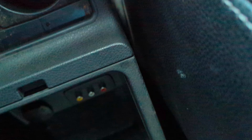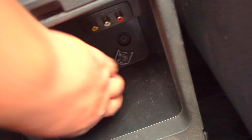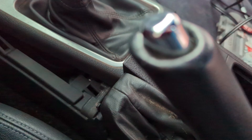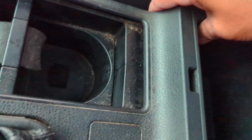I took all the stuff out of the center console area. You just take this little piece off and — oh yeah — you get free money from under there. I already got money back on my car. Pretty much just those two bolts in the back. You just need to move it out of the way. There's an Allen bolt up top and a star bit down here, so I'll do those two.